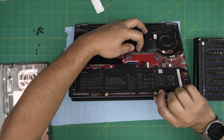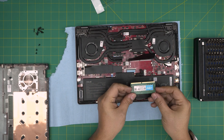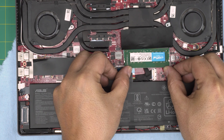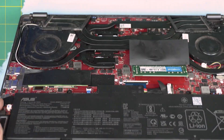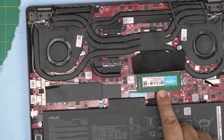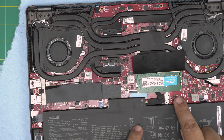There's a little notch on the DIMM, so if you try to put it in the wrong way it won't go through. Bring the stick in at a 45-degree angle, push it into the DIMM slot inward at 45 degrees, and you'll see it sitting at that angle. Then push it toward the motherboard — you'll hear the retention clips open and close softly. Once it goes all the way down it must stay straight. If the clips aren't staying straight, the RAM is not in place.